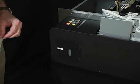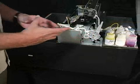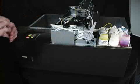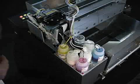To begin, we need to have the original bottles that came with the machine. If you don't have the original bottles — for example, if you had to use the white ink bottles — you'll need to take the ink and pour it out of the bottles and then clean the bottles out so that we can put our cleaning solution in.